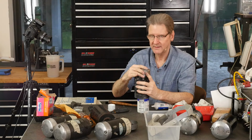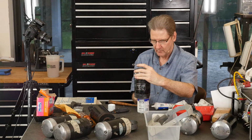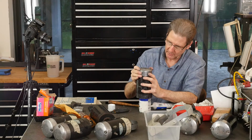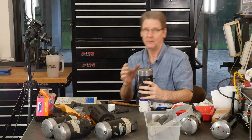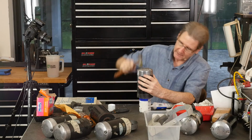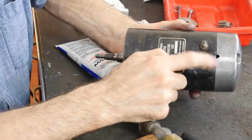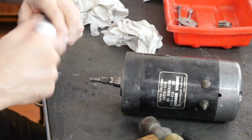See, it rotates and stops, so what's it hitting in there? Obviously shorting something out. Where's the bolt holes? I know that this little slot goes, oh, see, it's not, oh, okay, I know what's going on. What's stopping it is that roll pin. That was it. That little boss, it was going to one side of that boss, the other side, but not down. Now it's down. And of course, the tip-off is that this is all lined up in this stupid hole they put in the top that ruined this thing.